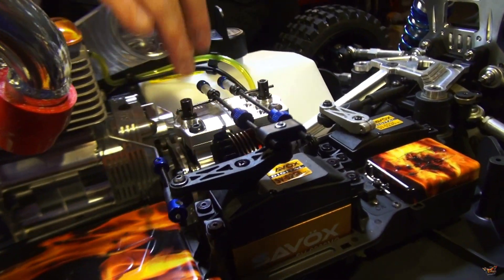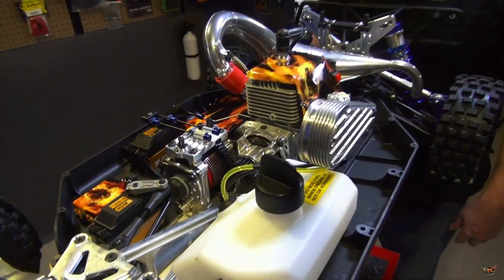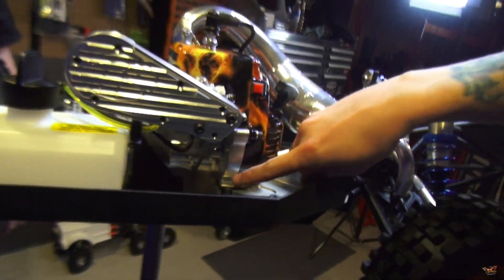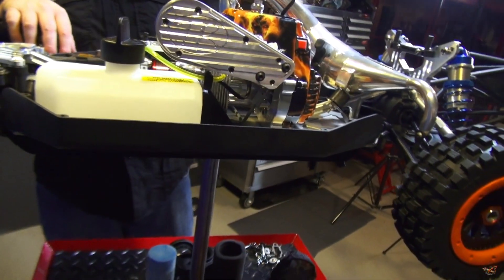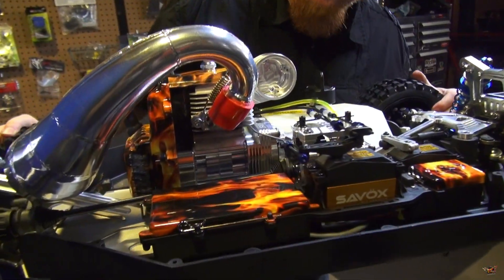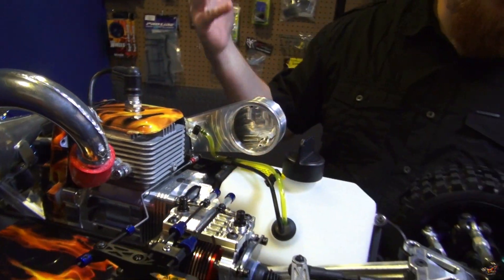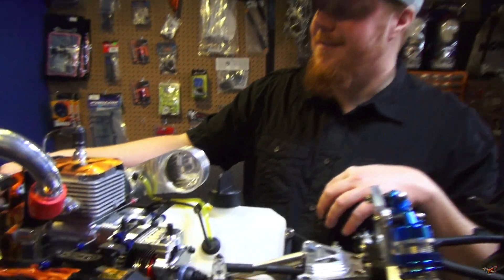I went with a Bartolone Racing carrier and clutch bell inside there too. Somebody asked why we'd do the mesh mod instead of just putting outer wares in there — spinning it around gives you your answer. We also have a different throttle linkage — that's a DDM linkage with a quick release right there. Very wicked little feature.